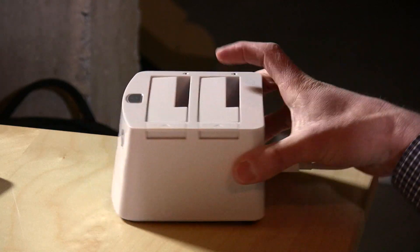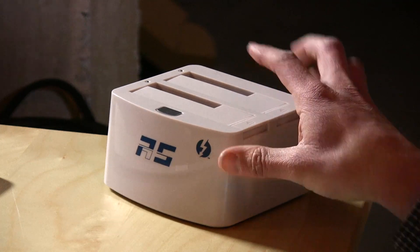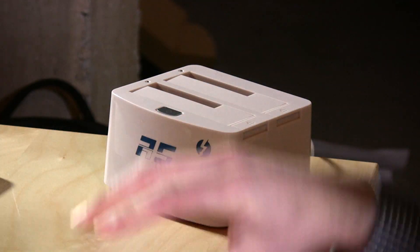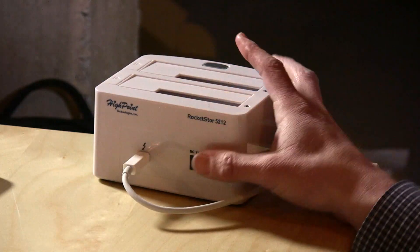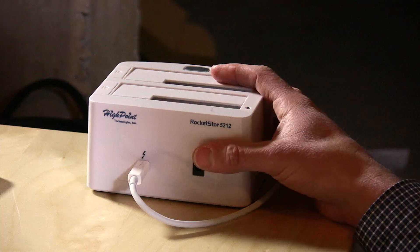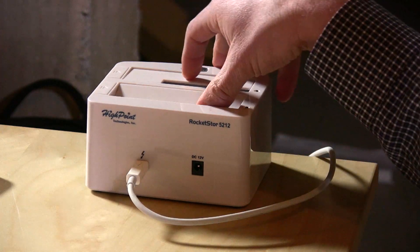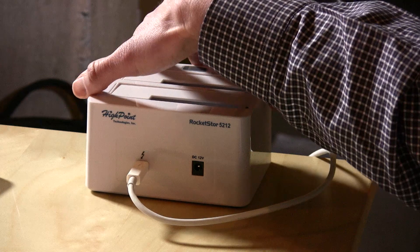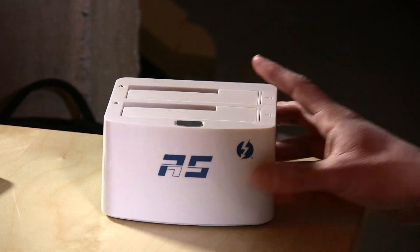There isn't much to this. You have two drive slots and you can use them at the same time. There are SATA 6 connectors in there, so it just lines up perfectly with the SATA connectors on the back of your hard drive when you put it in. It has two little eject buttons to pop the drives out when you're done, and on the back you have a single Thunderbolt port. Unfortunately, it doesn't have pass-through, so if you have a lot of devices this will have to be at the end of the chain — that's a criticism I've seen from other reviewers and it's certainly valid. It also doesn't come with a Thunderbolt cable, so you'll need to buy one. They usually run about $20 to $30 apiece, even for short cables — so two little gotchas there.